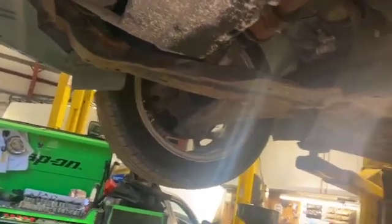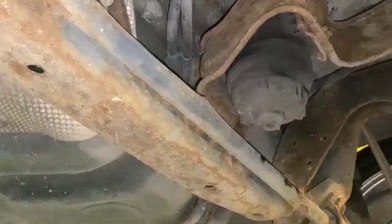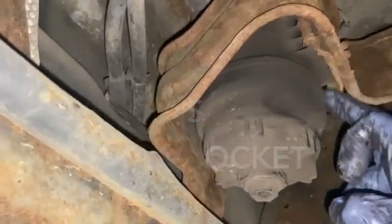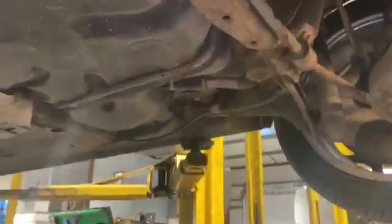Before we let the vehicle down, we're going to go to the back of the vehicle to change the fuel filter — we can access it from underneath. Come to the back of the car, just past the back axle, and look up. There's the fuel filter — again it's an element-style filter just in that housing, and we can use a 32mm socket on the bottom of it. Put the oil drain underneath to catch the fuel as well.